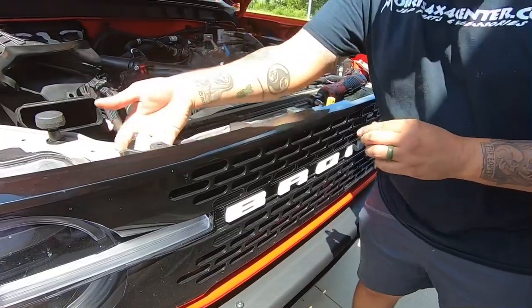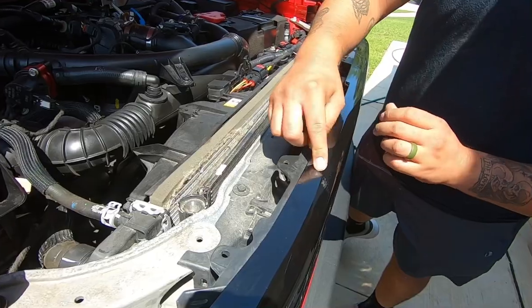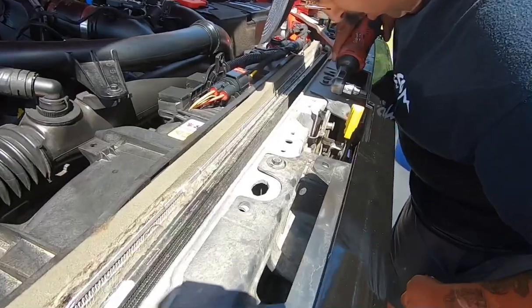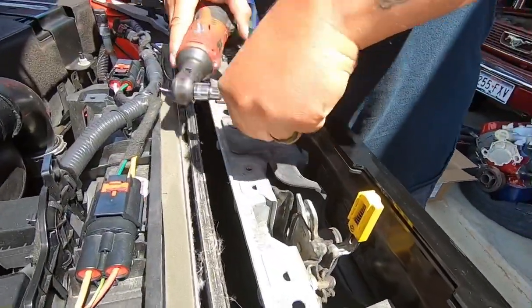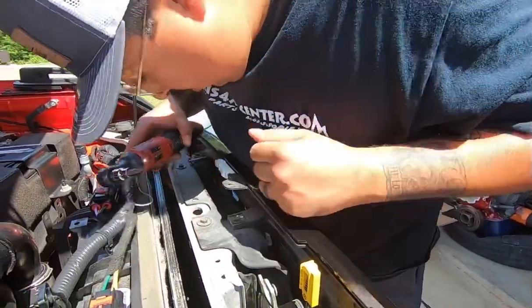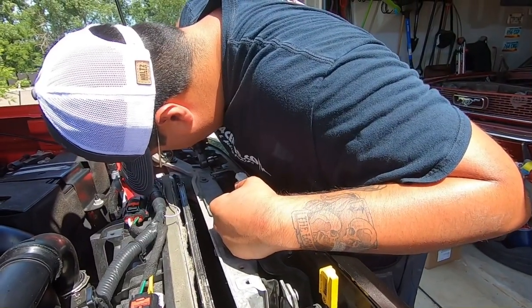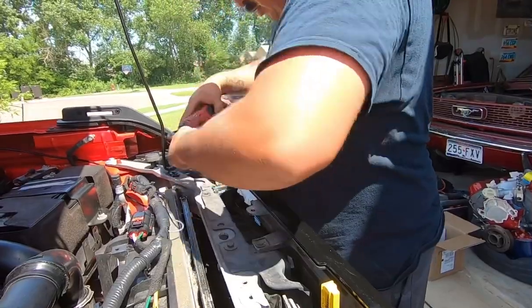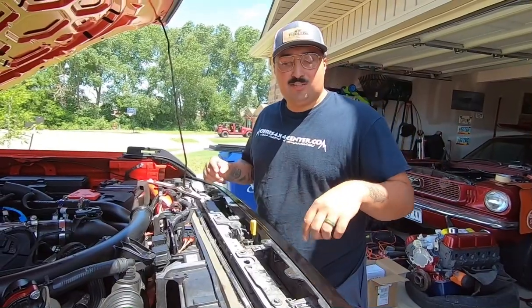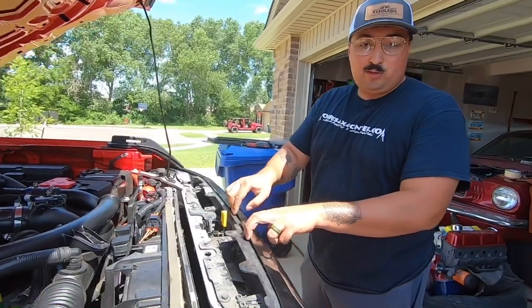So after you take off all the screws on the inside of the lip in the back, you can detach this piece from this piece and easily route your wires together. Just like that, very easy, especially with the electrical ratchet. And then you have a total of 4. So I lied, there was actually 6. There's 1 hidden underneath this middle tab all the way in the back. But after you do that, you can see your grill can move.